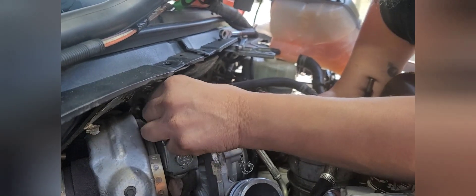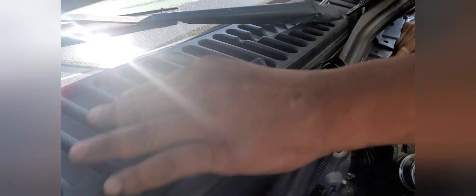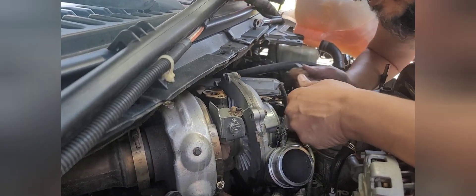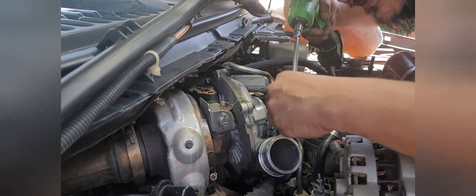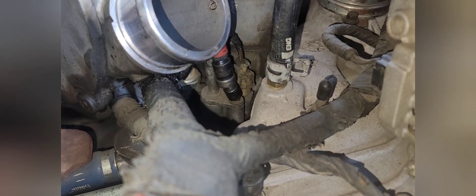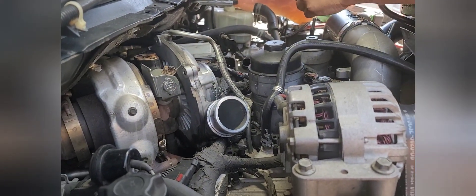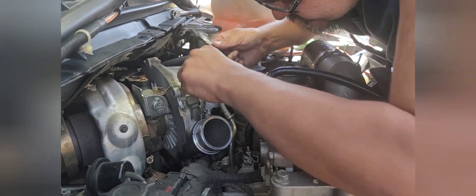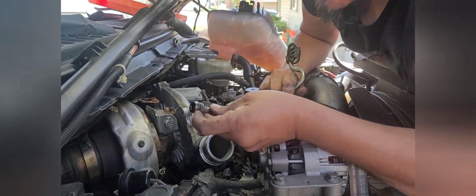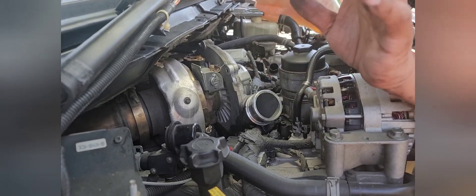If you don't have a tray for your hardware — I've done these many times — this stuff comes off dry, it's not wet, it's not going to break anything. Now I'm going to take out the oil drain tube. There's an 8mm nut or bolt straight down — take that out, get it out of the way, set your tools aside, and then you can pop this out. Sometimes it pops out easy, sometimes it doesn't. We're going to replace that O-ring — it comes in the kit.